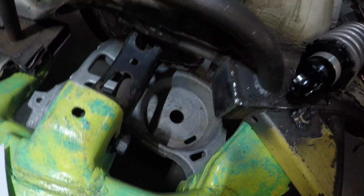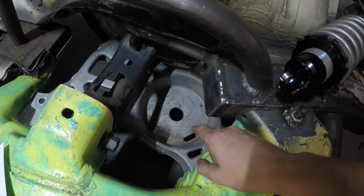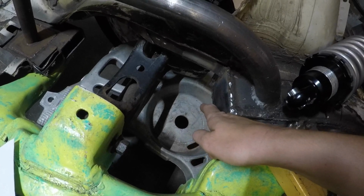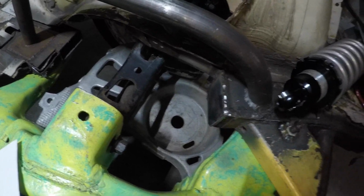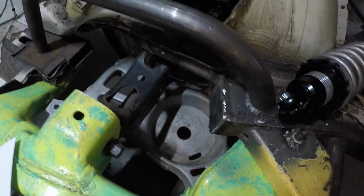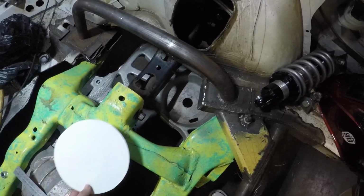7-inch 440-pound springs. So for the bottom mounts, I'm going to end up making 3/16 steel plate discs that sit evenly in the bottom of these lower control arm pockets, which used to be the old spring perches. I'm going to go ahead and make a cardboard template. Now it's time to cook up some steel pancakes.